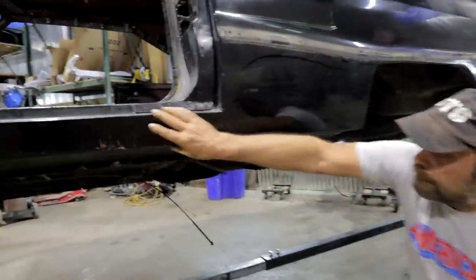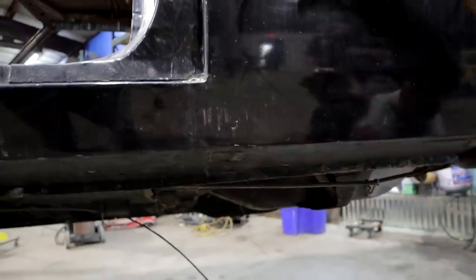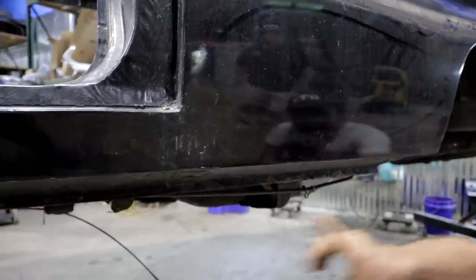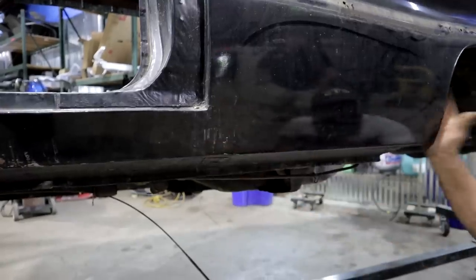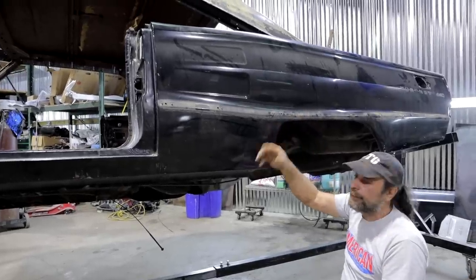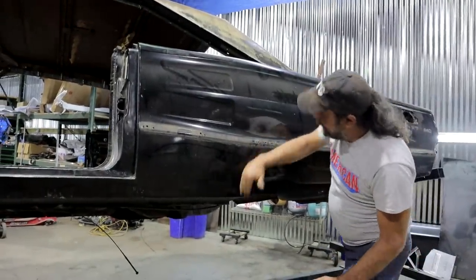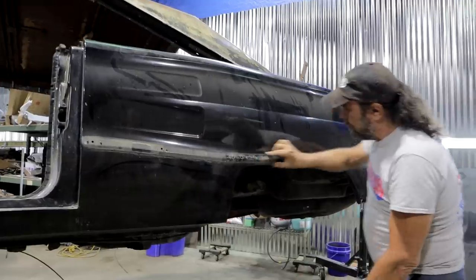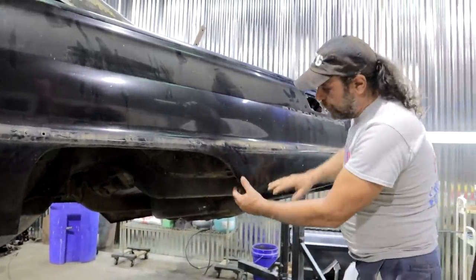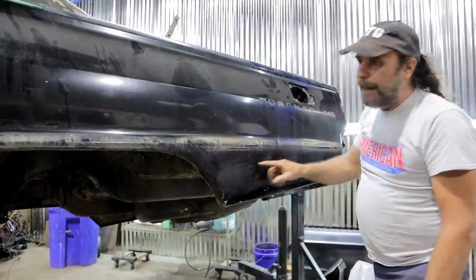If you look at the construction, here's the rocker. If you were to take this off, you'd see the rocker comes in about a quarter of an inch and then the skin fits over it. Over time, dirt builds up in this area — there's a little sandwich area, and this is a leaded joint. So from the leaded joint back here, anything that comes through the window — fine dirt, silt — gathers in here. The inner wheelhouse comes like this, and any moisture that comes in here gathers in this area, another common rust area. As you're going down the road in the rain, that water comes down in here, fills with dust and debris, the moisture sticks to it, and these things rot from the inside out.